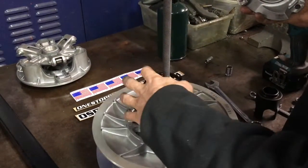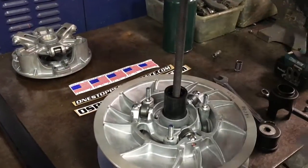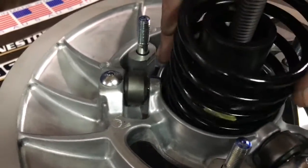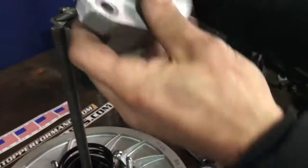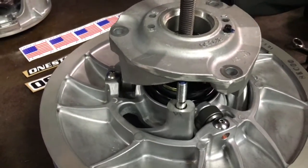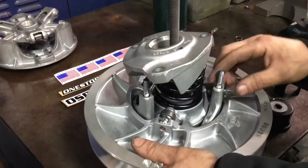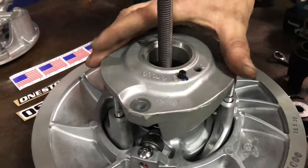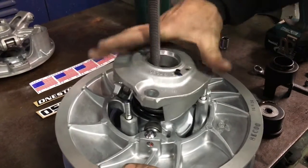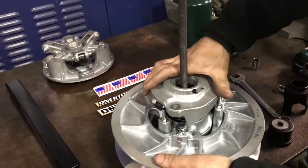We're just going to put it back to the way it was. This hole was in the number 1 position — we marked it right there. So this is going to go in there. And then we were in the number 3 position, so we're going to put this back into number 3. Now the converter, when it gets put back together, we're going to pinch it together. You'll notice how the tangs are all the way to this side — as we wind the clutch, we want to wind it into it so that as it shifts out, it always has tension to it.